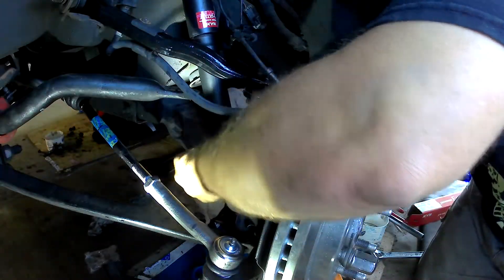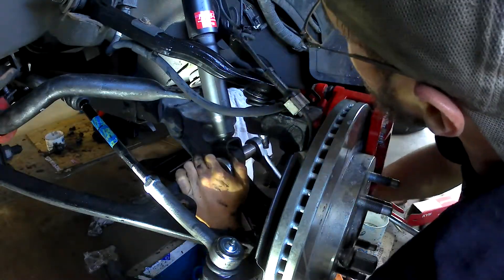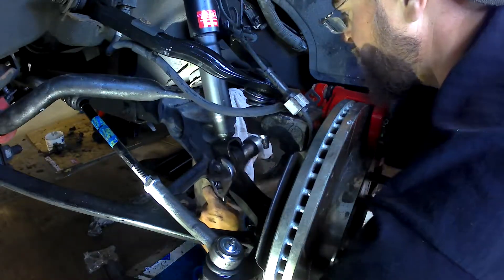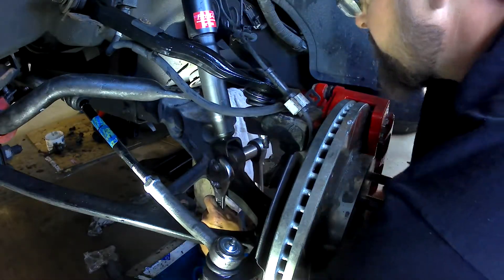Thankfully it's a cool day here. Go ahead and tighten this down here, pretty close to tight, because it'll still move as a rubber mount within the control arm. So you get this tightened down and it's still gonna move back and forth, which is kind of an ingenious idea to think about.